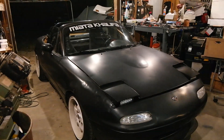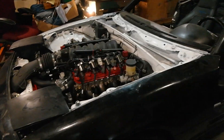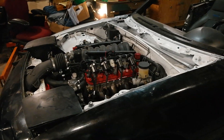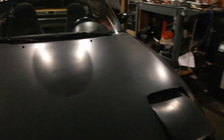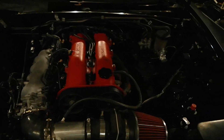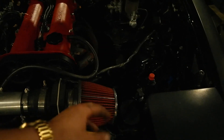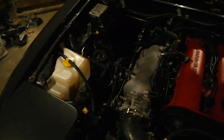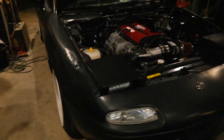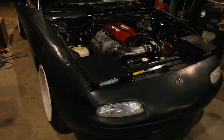I have Miata Khalifa in the garage to come meet her brother. I haven't revealed what the name for this car is yet, but it would make sense if this one's a dude. It's just really cool to look at what a stock Miata looks like compared to this one. Honestly, I think the V8 looks like it fits a whole lot better than the four cylinder does. I made it cleaner — took off the AC, the power steering pump, the condenser, the EVAP charcoal canister stuff — freed up some room in the engine bay. That's just really cool to look at them juxtaposed. I'm kind of going for the same theme on this one. I like black cars, it just is what it is.